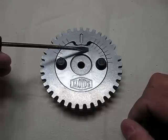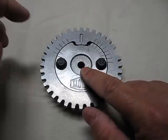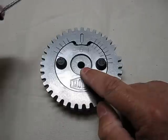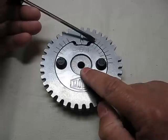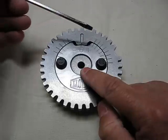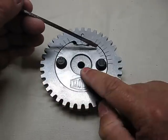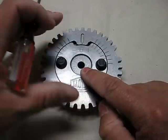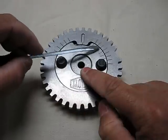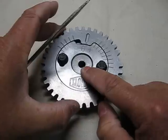You can see there's also a positive side and a negative side. These lines on the positive side — when you turn the outer gear and you line up the first set of lines, that is plus one degree because we are on the plus side. When you turn it a little more and you line up the second set of lines, you are at plus two, and so forth. You can line up three — when they're lined up you're at plus three. Plus four, all the way up to plus eight.